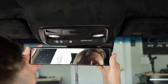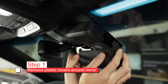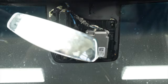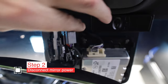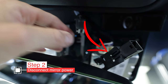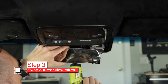To get started, let's remove the overlay that Adrian had on his mirror — he won't need that anymore. First, remove the lower plastic cover by squeezing the sides as you pull it down along the windshield. The top part pops right off too. Once the covers are off, you'll see a connector hiding just above the mirror. Slide it out of its resting spot and disconnect it by pressing the tab on the backside. Then remove the T20 Torx screw underneath, and lift the mirror towards the roof — it comes right out.